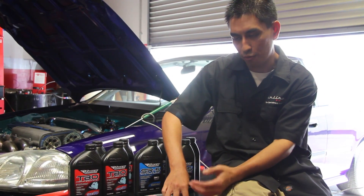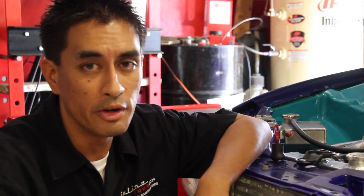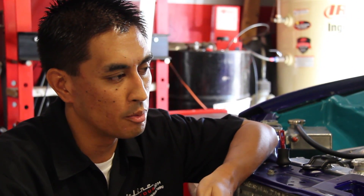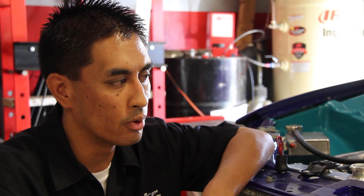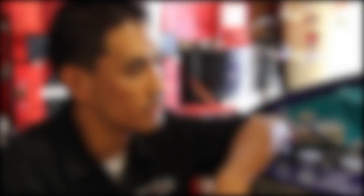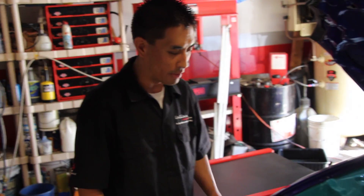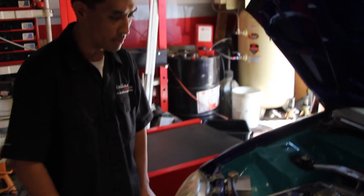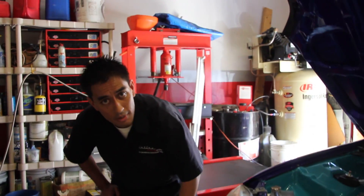Copper plugs come with a gap, but you're free to experiment with different gaps, knowing that you only pay around $20 for the set versus $60, $70, or $80 for iridium. I also wanted to mention that this car was towed here. When you build a motor of this caliber, 9 out of 10 times you're not going to have the proper ECU program or mapping for this type of build. You want to make sure that it's correct — you don't want to just get on it with the wrong tune and hurt something. So you tow it up here, and it goes straight on the dyno. He had it start up, made sure the fan turns on and all the diagnostic checks were okay — maybe a little spin around the block — then shut it down and towed it right over to us. That's good practice, even in a high compression environment.